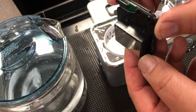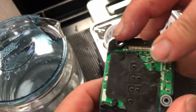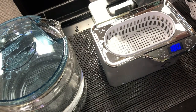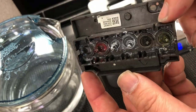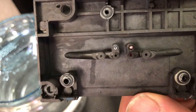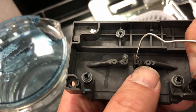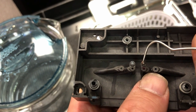How about a printhead? Do not clean this part of the printhead for an Epson printer. That's because the Epson printer has a membrane in it. If you clean it, the bubbles are going to break the membrane, and you'll get all the colors mixing with each other, damaging your printhead. Instead, you can use the ultrasonic to clean the top part. When you have a clog, people tell you to push ink through it. However, if this top part is clogged, you need to clear this part first before you push ink in — otherwise all that debris could get pushed into the printhead and make things worse.